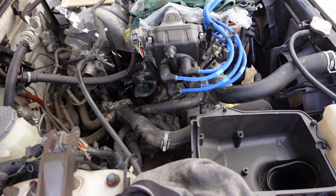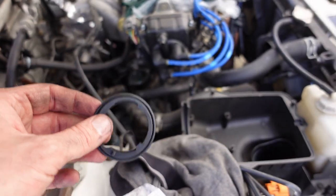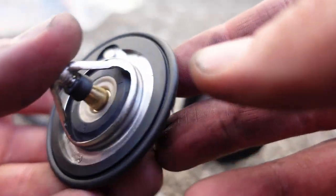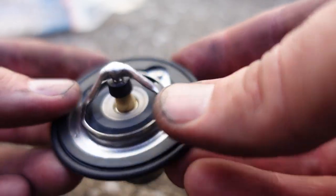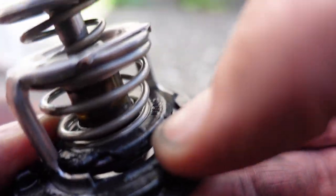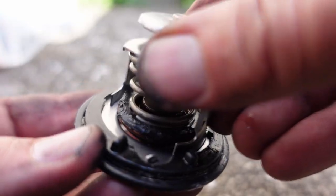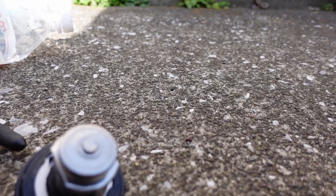Now I just got to plop that back in there. It's a purely gasketed system — there's no RTV necessary, which is awesome. Nissan guys will get a kick out of this: it's only two bolts that hold it on. No RTV required. Like such an elegant solution — a really high quality fitted gasket that goes completely over the things. And while we're here, this is the old one. I thought it looked weird coming out. This inner diaphragm seal, it is just chunking out. It's all breaking down. Just sludge. So I'm really happy I'm switching this now.